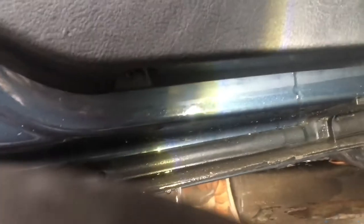Once again it comes out the bottom of the door. But if we look closely, we've got a tiny leak in the middle of this one here. All four door membranes are leaking on this one.